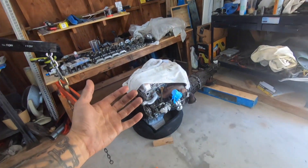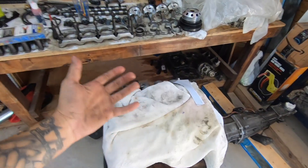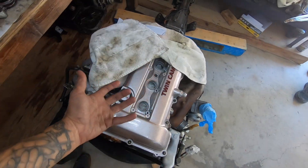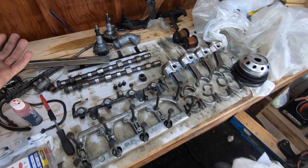What's up guys, welcome to today's video — this is not the video I expected to be putting out today, but I guess it is what it is. You guys can tell by the title: the SR is not going in the engine bay. We basically realized as of last night that the cam caps I used for the SR — you're not supposed to mix and match cam caps, and I didn't even think about it. The head we put on this car was a freshly built head, and the cam caps I used were from my old engine.